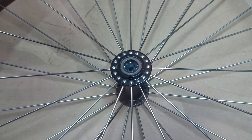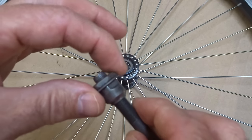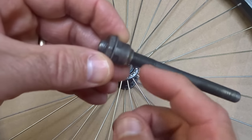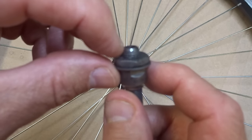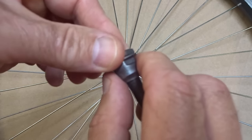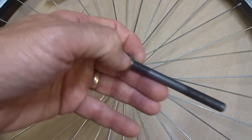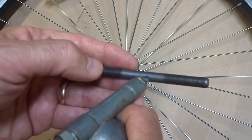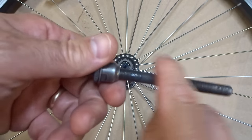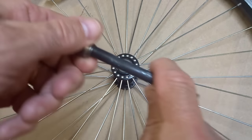So I got that done and now I'm ready to reinstall the axle. I didn't remove the cone, lock nut, or washer from this side, but that's okay. If you do remove them, just make sure when you reinstall, leave about four or five threads of the axle sticking out that side and tighten them up against each other. Before I install this, I want to put a thin coating of grease just on the axle itself — not as lubrication, but more as corrosion protection so you don't have just bare metal in there. Then I'm going to slide this through.